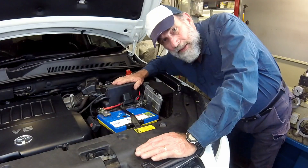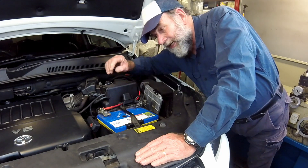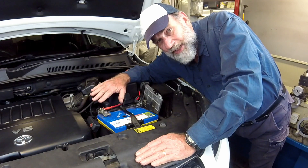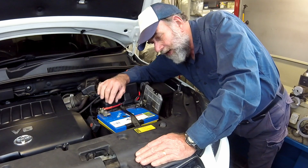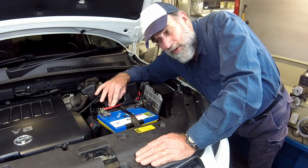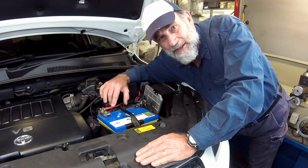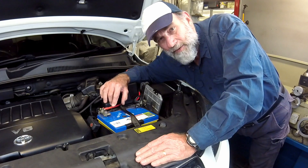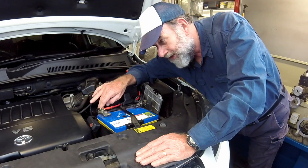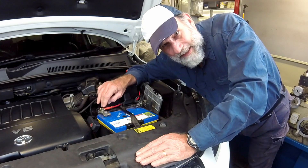This is our Toyota RAV4 and this is what I've set up the wiring in. I'm not going to show you the wiring of the car because it will change from vehicle to vehicle. What I am going to show you is the general layout of the wiring and talk about factors you need to take account of. If you read the instruction manual it will tell you to take power from the alternator — you can do that, it's down there — however there's a line that runs directly up to the battery from the alternator and it's a whole lot easier to just take power from the battery terminal itself.